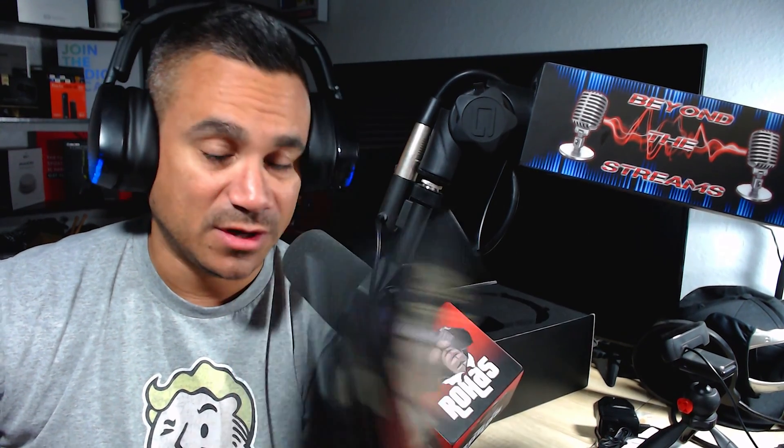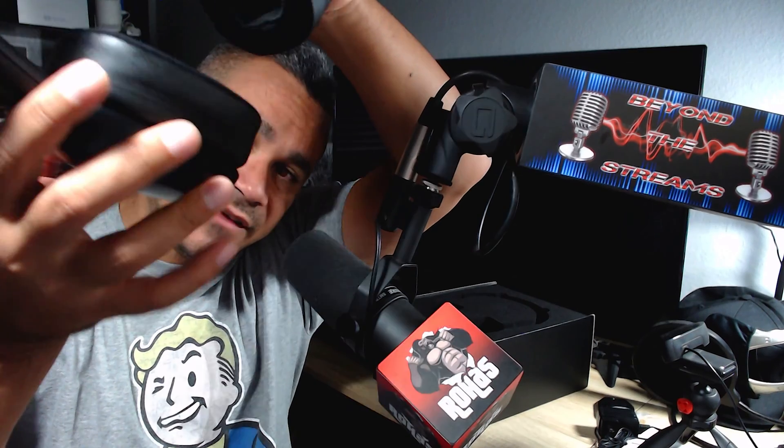Same thing with your phone if you're not able to find the headset — turn the Bluetooth back on and make sure it is in scanning mode. With some of these headsets it does have a dedicated Bluetooth button. Mine's right here on the right side. Hold it for like three seconds and you'll hear a notification that says 'Bluetooth scanning' or 'Bluetooth on' — something like that.